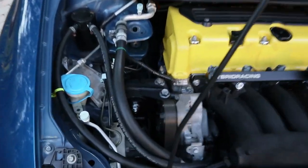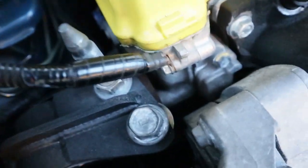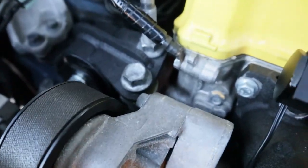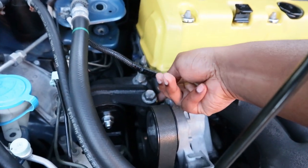The only thing I'll say is go buy some washers, because for some reason the Innovative mount doesn't reach flush — there's a gap. Quick fix: I went to Ace Hardware and got a couple big washers, placed them underneath the mount, tightened it down, and now there's no space. I did test the car after installing those washers — did some pulls — and the motor is solid. I'm going to add washers on the other side too. I have 20mm washers — super big but it'll work for what I need.